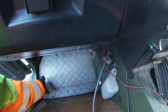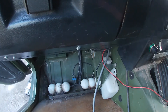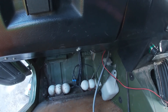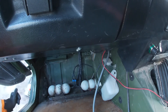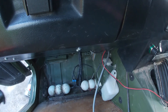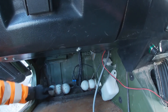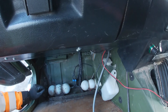Under those four bolts we can get this panel out. Under this panel we've got our air system coming in. I'm going to give all this a bit of a clean out — there's some muck and mud that doesn't need to be in here. We're going to test that these hold air and that the non-return valves are working. They should be pressurizing and generally everything should be going as it should.